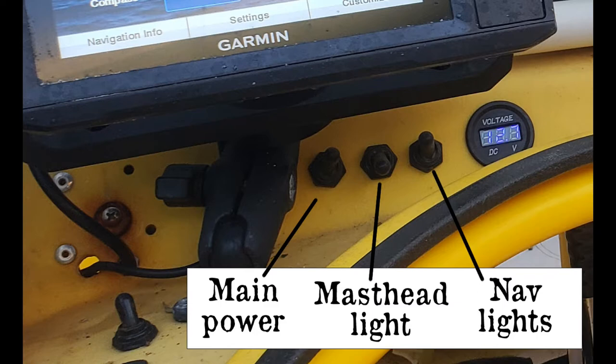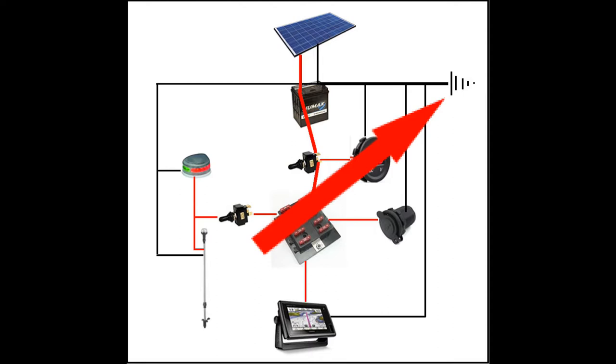It's redundant, and obviously you wire the compass light to the nav lights. Now that ugly rusty mess under the GPS — that's a stainless steel screw but not a stainless steel washer, which wasn't a problem in Michigan but became one in Texas saltwater. That's the back side of my main ground: I drilled the hole, put the screw in, bolted it front and back tight to the boat, sandwiching the main ground wire straight from the battery. Then I ran an individual ground for everything, so if I have to take anything off or replace it I don't have to cut any wires. I just crimped eyelets on each wire, put them on the screw, and tightened a nylock nut and washer on the bottom. It's a good solid ground for all electronics, and if there's ever a problem I know exactly where to look.